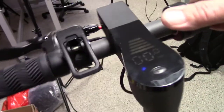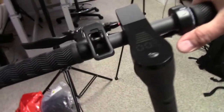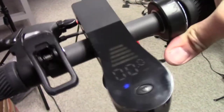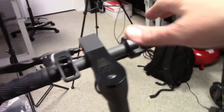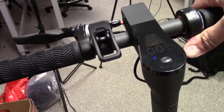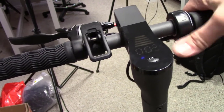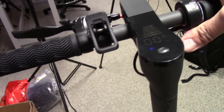So what that tells me is there's a lot of the electronics here that's working like it's supposed to. The motor's moving. The battery's charged, it's turning on the controller, the electronics are coming up, so the display is shown, but it just isn't going anywhere. And if I had both my hands available here, when you put this on and then I put the brake on, you'll also get that pulsing because that little switch that I just showed you is telling the controller to do something with the cruise control, but it's not moving, so it doesn't do anything.